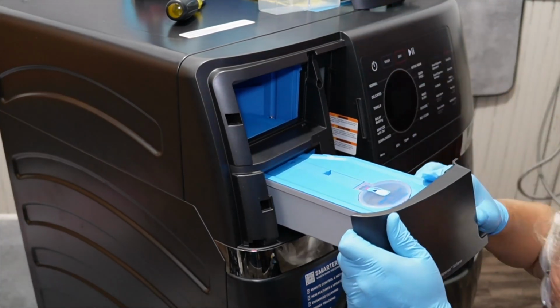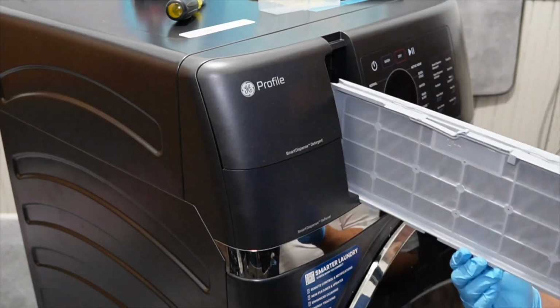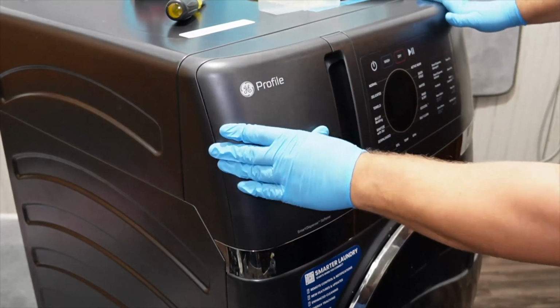Once you have all 5 screws into the dispenser and interface securely, you just have to insert the dispensers into place. Know that the bottom smaller dispenser has a groove at the bottom of the housing that needs matched up for it to insert properly into the housing.